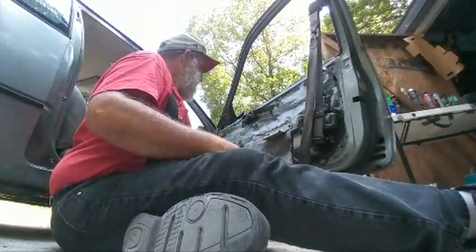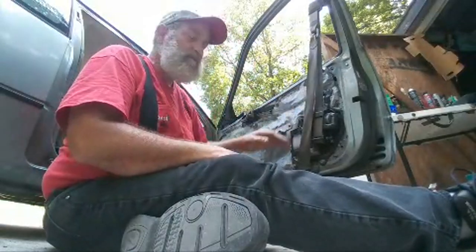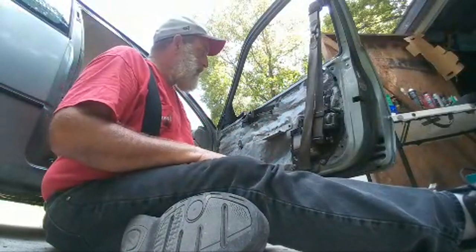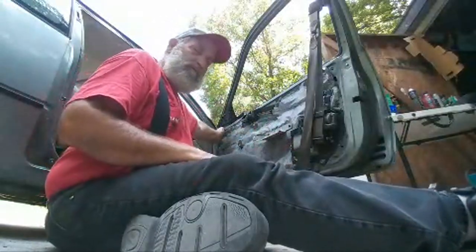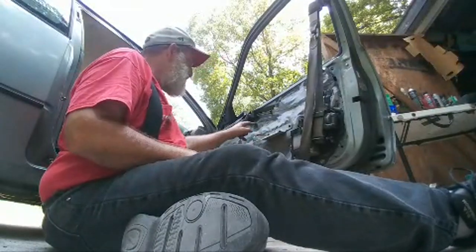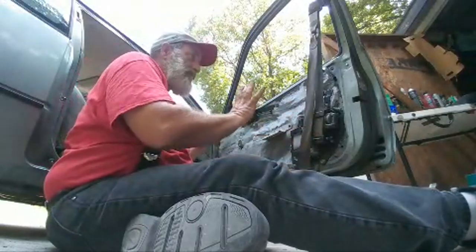And we'll just go with that. Now, the thing is, if this was a 100% restoration and this vapor barrier was something I wanted to salvage, I could get crazy and mask it off and use some spray adhesive. But we're not there. So the duct tape will do what we need to do. Primarily once we get the panel on, all these intersecting holes will hold that vapor barrier up if the duct tape fails. We're really just trying to hold it while we reassemble it.